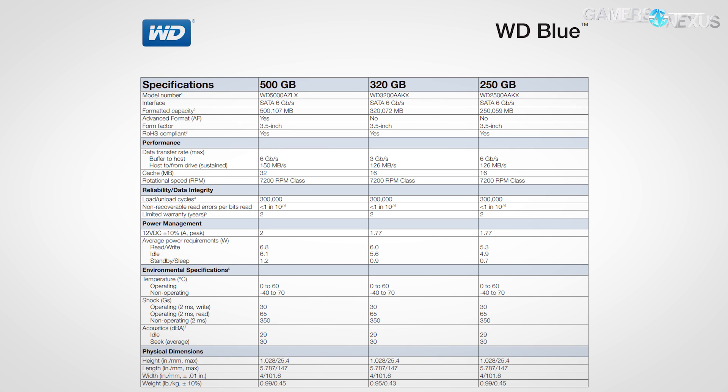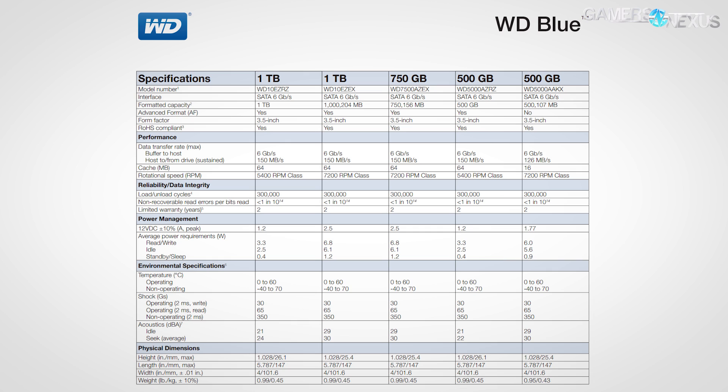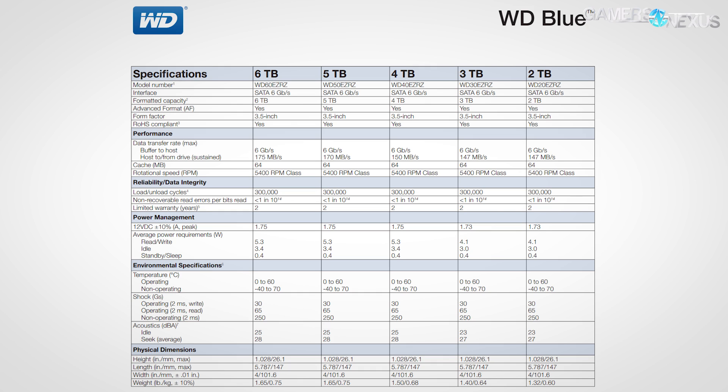The 7200 RPM version is limited to 1TB, so if you want more than that, you'll have to go to WD Black unless you're okay with a 2TB and higher 5400 RPM drive, which we generally would not recommend for gaming storage or media that needs to be accessed quickly. For long-term archival storage, it's fine. The more noticeable difference is the two-year warranty and the fact that WD Blue drives are significantly cheaper per gigabyte than WD Black — around $50 for 1TB 7200 RPM versus $77 for the WD Black. WD Blue is available up to 6TB for $200, but those capacities only spin at 5400 RPM and are for bulk storage. WD Blue drives have historically used Marvell controllers and Samsung chips for the cache.